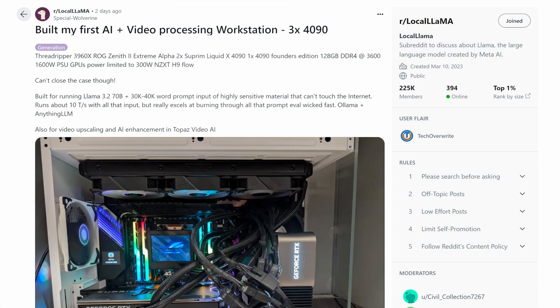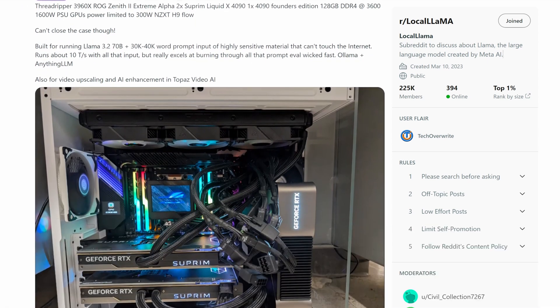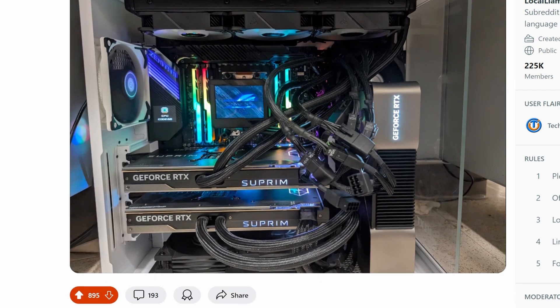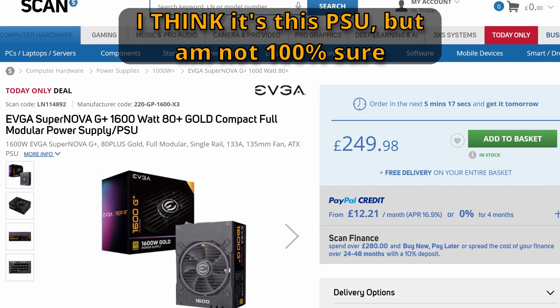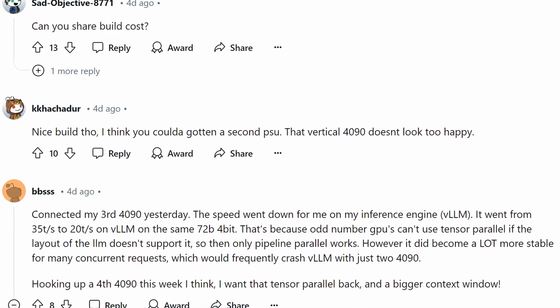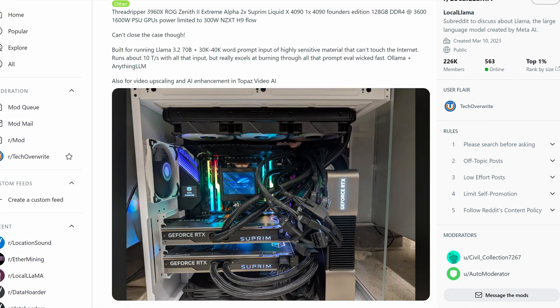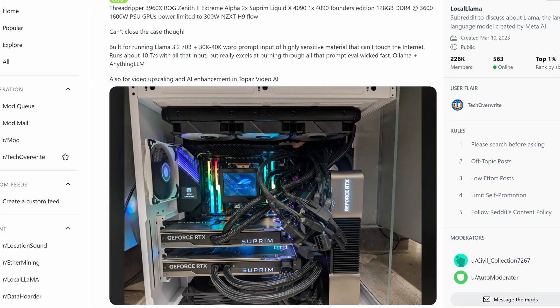So for consumer systems, even higher-end ones, you almost certainly don't need a multi-rail PSU. There was recently a post on Reddit about someone who made 50k in stocks overnight and built a really fancy AI system with three RTX 4090s — totally not jealous. That had a Threadripper CPU too, and although they had power-limited the GPUs to just 300 watts each, the entire build was running from a single EVGA PSU, which appears to be a single rail PSU. Some of the comments suggested the OP go out and buy a second PSU entirely, and I actually think that would be better than upgrading to a multi-rail PSU in this case — a build like that would push the limits of two 12 volt rails quite a lot, whereas having two separate PSUs would allow better splitting of power delivery in a more stable way.